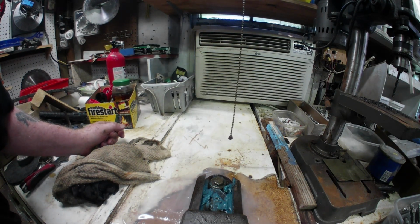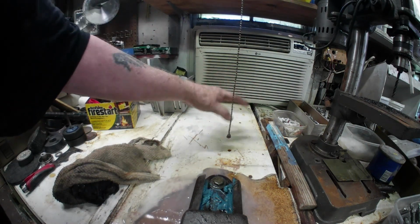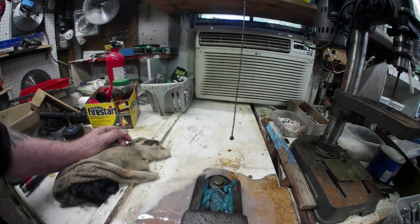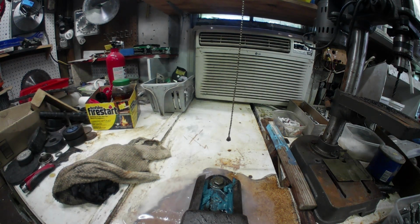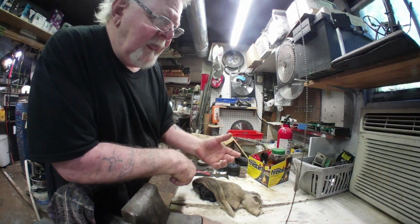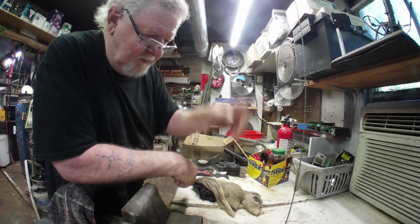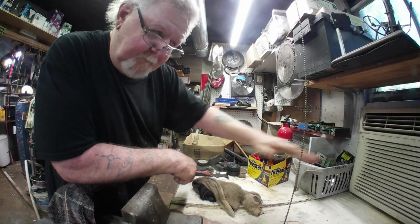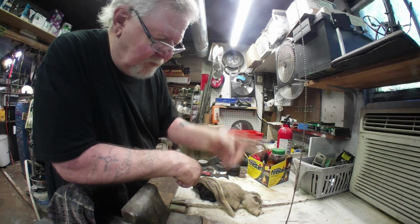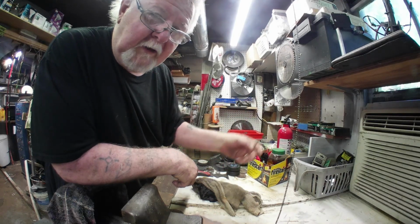The only thing I can possibly think of is that maybe there's just a little drip coming from someplace, and when I wipe back up there or feel, I don't feel it because it's not there anymore. It's just hit and miss, which means I can raise the air conditioner a little bit. See how an air conditioner works, these window units, they kind of sit in a splash pan. It's part of the actual framing. And the fan is in there. So when these things sweat, that pan fills up with some water. And it helps keep the air conditioner cool, because as the fan blows by it, it sucks that water up into the air conditioner and cools down the back end.